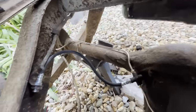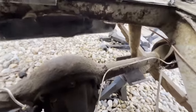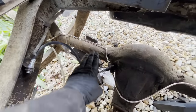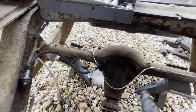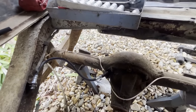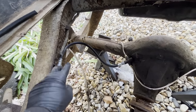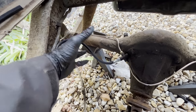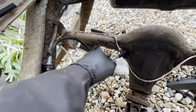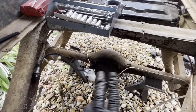So because of how the joyous people at BMC made these, you get the floor up as we've seen before. And there we are - I've just screwed the pre-made pipes in. Not bad. This one was slightly too long so I've had to go up and over the top of the axle a little bit. But we've got a nice sweep on there, which is how it was from factory. I must say it's very, very nice actually, very convenient. Just put this line on, left that top nut loose - screwed it into that end tight first, then that lets you have a gentle route without it twisting your line. So that's the rear brakes hydraulically and mechanically sorted.